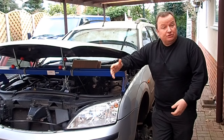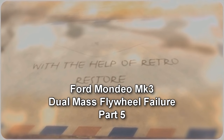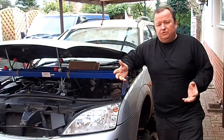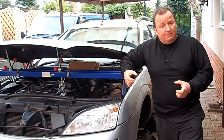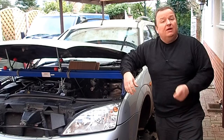Okay folks, this is part five in the Mondeo gearbox-out job to change the DMF. While this subframe was stripped down and I've got all the parts to rebuild it, let's give it a bit of a cleanup — this is really the only opportunity I'm going to have to do this. I'm going to take off the lower wishbones, replace them, also take off the anti-roll bar and put the new rubbers in, give it a bit of a spruce up and a paint up, get rid of all the grease that's been sitting around for the past decades.